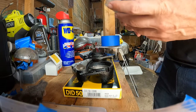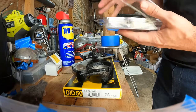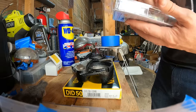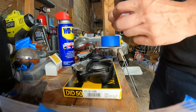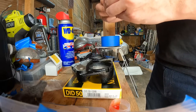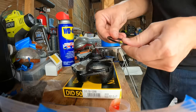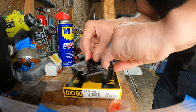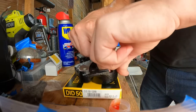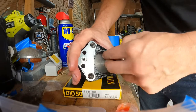First thing is, the Brake Crafters kit comes with the red rubber grease, all the goodies you need. So we'll do one side and the next. We're gonna get everything with a light coat of red rubber grease first. I can't believe I never even heard about red rubber grease until about 2 years ago. Anyway, the seal just pops in, pretty straightforward. Okay, that's done.